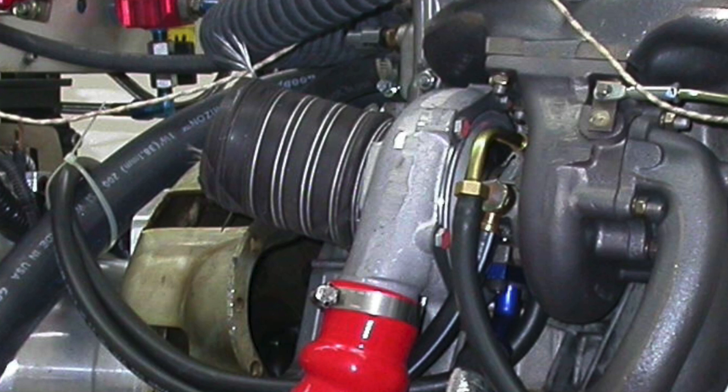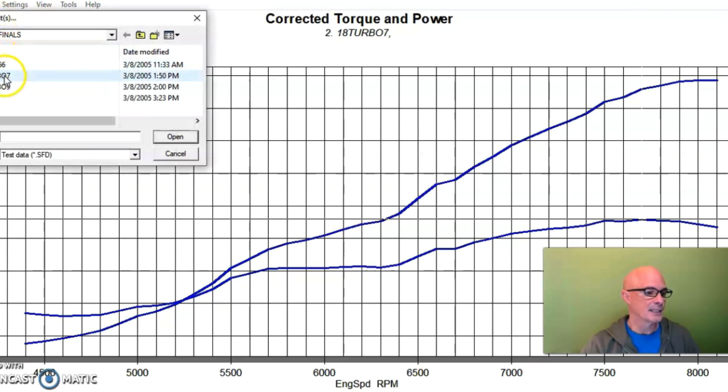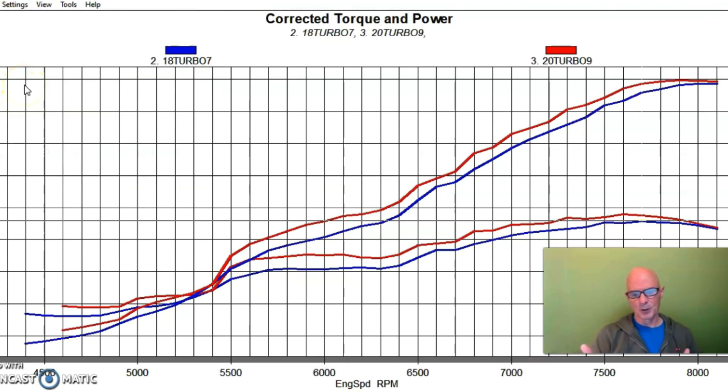I want to show you on both sides that the intake manifold is really responsible for the big change in power we're seeing, and that ultimately affects boost because it affects how the turbo spools up. With the P30 intake manifold, we made 321 horsepower and 214 foot-pounds of torque. Running it again shortly after — with more heat in the system — we saw a little more boost and a little more power, though the peak was very similar. Basically better turbo response.